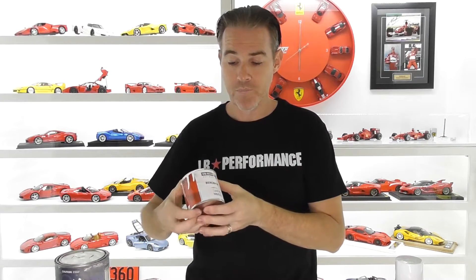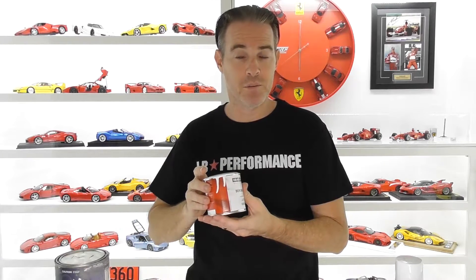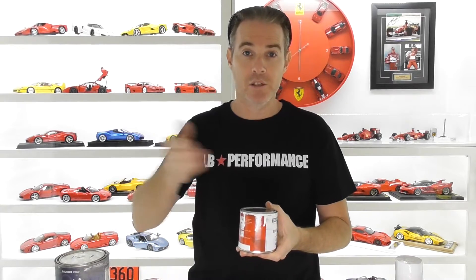Because I use automotive paints I can use what's called base coats. Any automotive paint store can mix these into any Ferrari, Lamborghini, or particular color you want. Base coats are a straight 50/50 mix — 50% base coat, 50% thinner — which gives you the exact consistency to spray from your gun. The big advantage is that base coats dry in around 15 minutes, so you can apply multiple coats in an hour. If you want to add a pearl coat on top of the color before your clear coat, pearls are exactly the same: 50% pearl, 50% thinner.